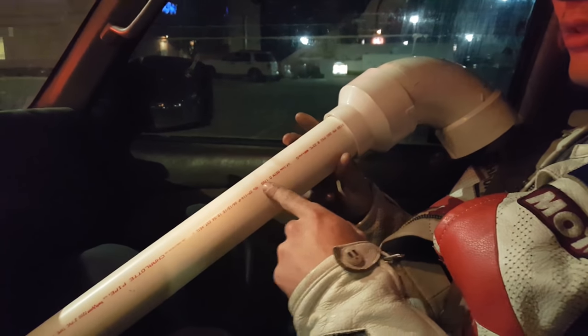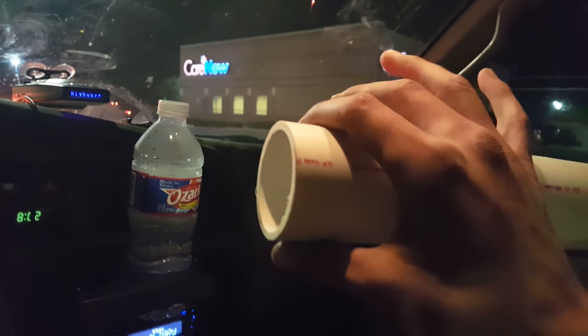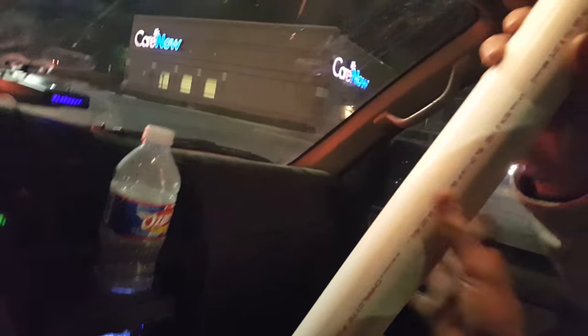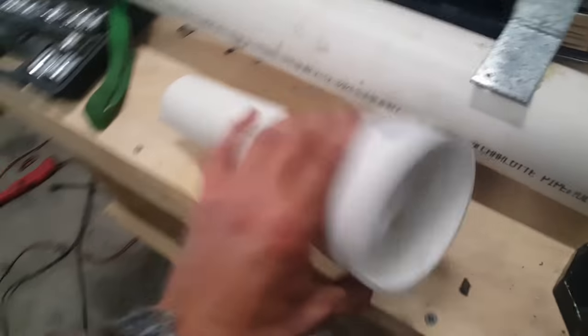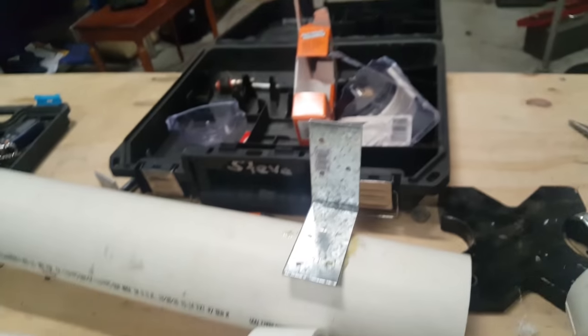There's no need to take the fender off — this is going through the hole. The airbox comes out and we're gluing it inside the airbox, not inside the fender well. The PVC piece is either going on the inside or outside of the airbox — it's a little piece of plastic pipe that comes off. Alright, so it's slowly starting to come together. We're going to put this end in there so it fits through both holes, and this coupler is going to attach right here. We're going to gorilla glue this piece in and let that sit for a bit.